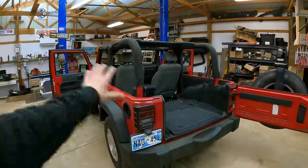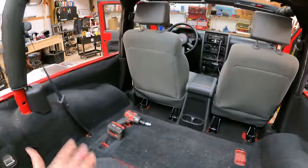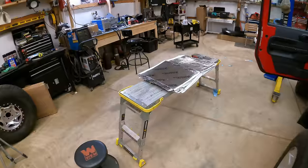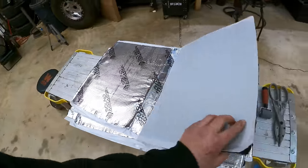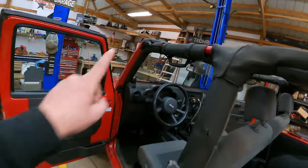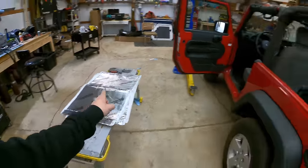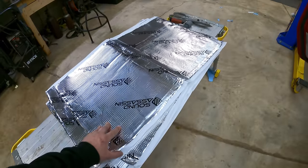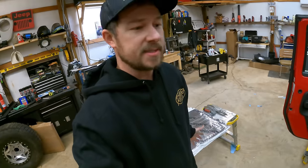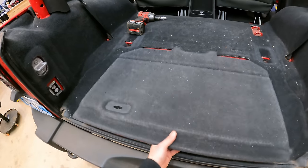What we're going to do now is pull the carpet out — pretty much just the carpet and seats — so we can start installing the Sound Assassin floor strips. What they are, theoretically, if you're familiar with Dynamat, is just a sound deadening material with a nice self-adhesive on the bottom, very similar to what we just installed on the strips up top. This is the Hothead Headliners brand of sound deadening material — the full kit for the two-door, which means we get 12 of these large pieces. We're going to have to cut them and make them fit, but this is probably going to make the biggest difference. It's honestly not too hard — we just have to start one piece at a time.